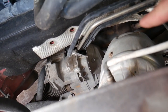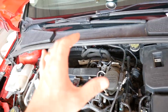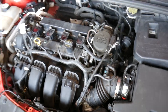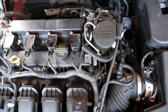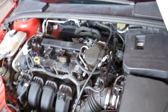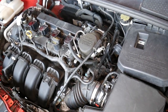The second oxygen sensor is on the bottom, past the catalytic converter. This one detects whether the catalytic converter is doing its job and that the exhaust gas is clean and not polluting. Now, let's say you replace that sensor and you still get that code again. Probably not a bad sensor — it could be something very simple, which we'll explain now.